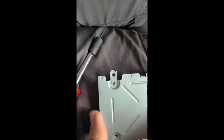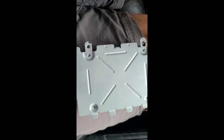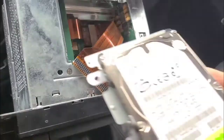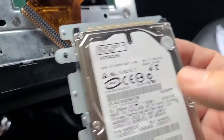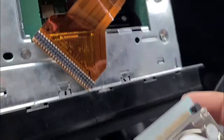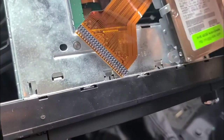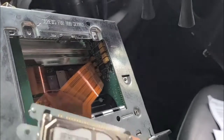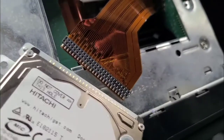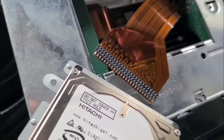That's the old one, that's the new one — we'll just put that on here and reinstall these four screws. Time to reinstall. The new hard drive is mounted to the mounting plate. With the label up and the wide band on the ribbon, it goes like that. The ribbon needs to go in that orientation — you need to match up the pins. Then we'll put everything back together.